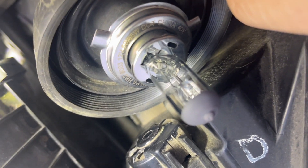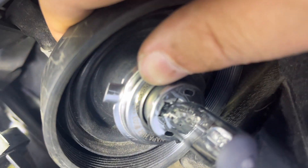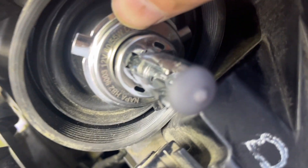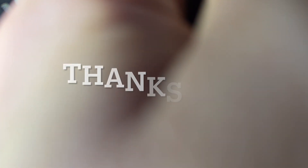Don't ever touch the light bulb itself — don't ever touch the glass. Whatever you do, do not put your fingerprints or grease on it — that's rule number one. Number two: when you put this back in, push hard — it's got a click, you'll hear a click. You think you've got it all the way in? You don't — push real hard until you hear that click. I'm going to use my finger to lift this metal piece up, then place it in and twist it in.